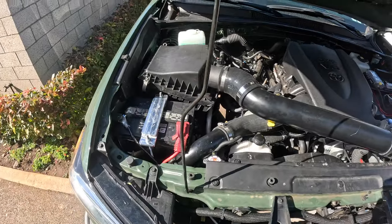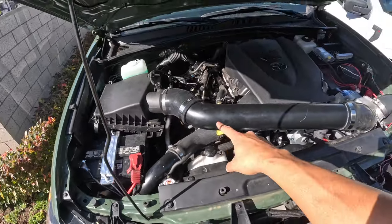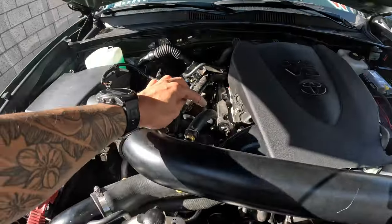It's actually the next day — I got it running around eight o'clock last night and kind of just buckled down to finish it up. You can see now the pro charger is installed. I had the battery in, inlet tube, air box — everything plugged back in. After I got it running I just wanted to button things up. The stock PCV hose was actually a little short, so I ended up picking up some five-eighths hose and cut it a little longer — that way there's more hose on the fitting.